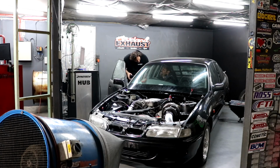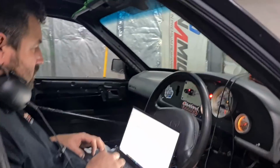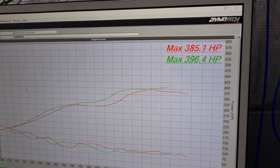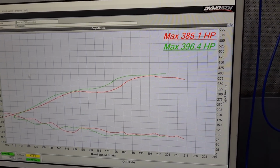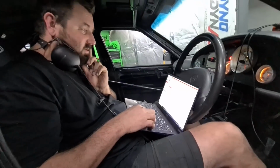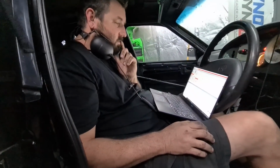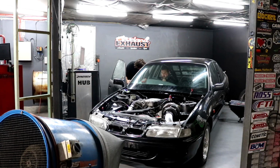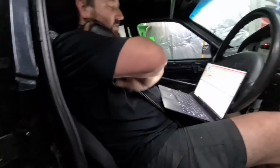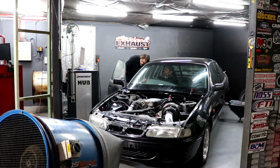Firing, eh? Sounded like it was missing and carried on. Holy shit! Right, fine, send it. Was it misfiring? It sounded, yeah, there, yeah. Sounds like it's breaking down. Unless it's just that one plug. Yeah, or it's got a damaged valve seat. Maybe.